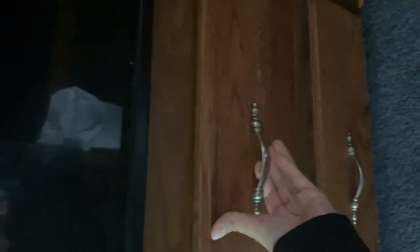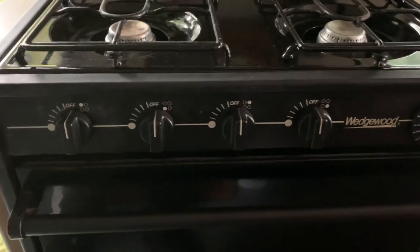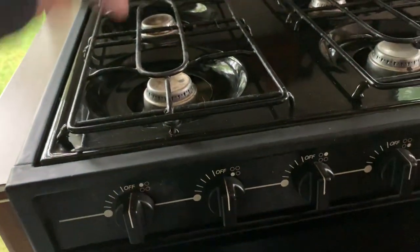Let's start right here. It is a gas oven with two drawers underneath. All the drawers in the RV you have to lift up first to slide out — that way they aren't sliding open while you're driving. Here's the gas oven. To use the oven you need the long stem lighter, which I leave in the RV. You open this, turn the gas on, reach up in the top part, and light the flame. Same thing with the top burners — anyone familiar with a gas stove: turn on whichever burner, let the gas come up, use the long stem lighter, and light it.